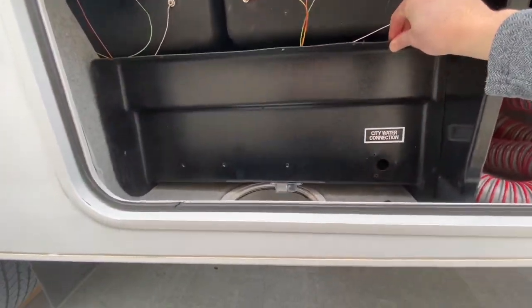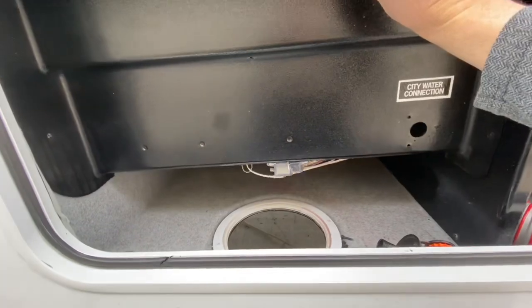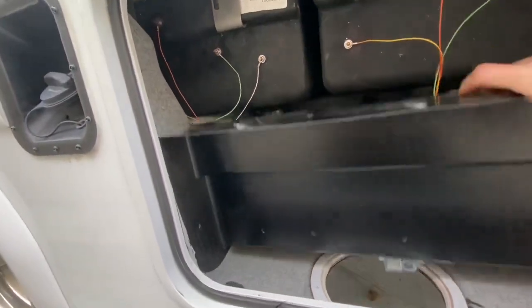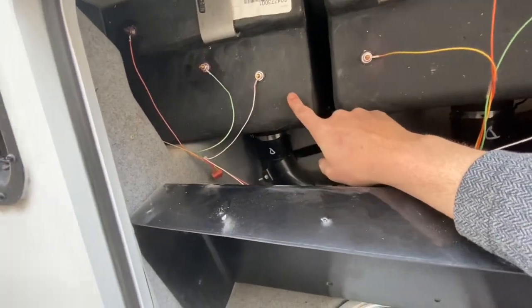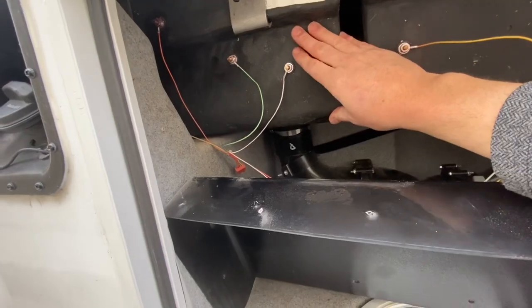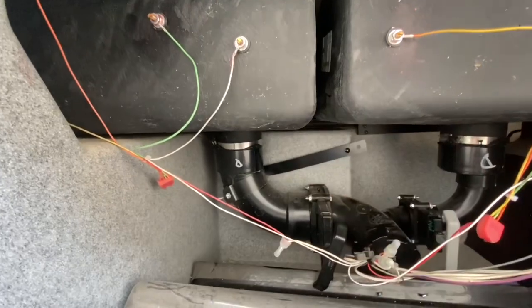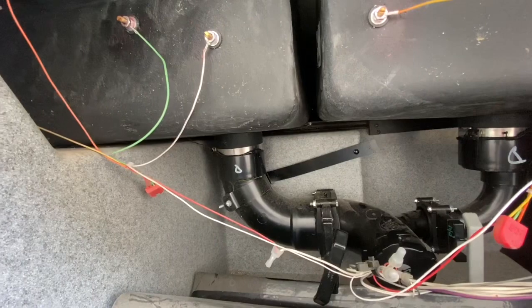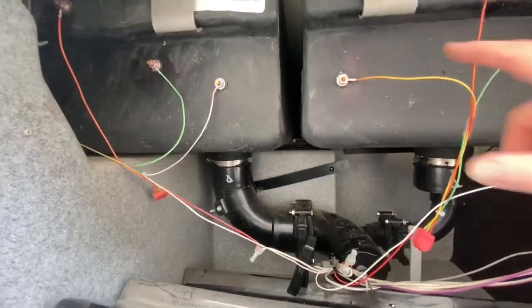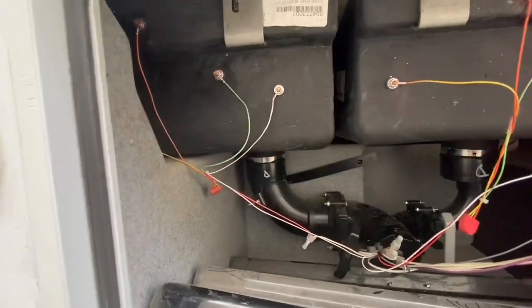This is the Sunseeker 3250, it's a 2019, and it didn't come with black tank flush. This little tray here is in the wet compartment — I took this off to get access to the black tank. Black tank's right here; I can tell because that's our black valve. This is the only exposed surface of the black tank. It goes basically above the frame rails and it's all in a closed compartment, which is good — easy to keep it out of the weather. The gray tank is right here too, but it's really limited as far as options for mounting this tank flusher.